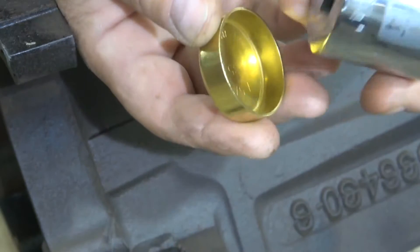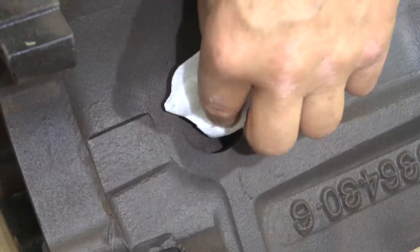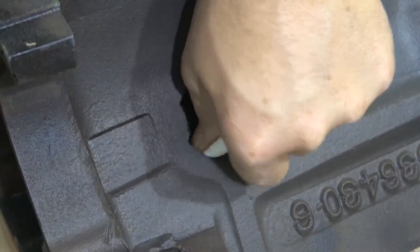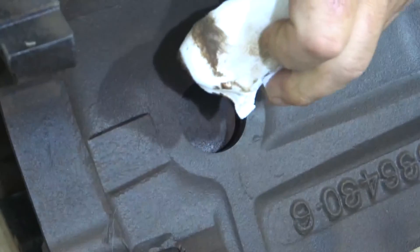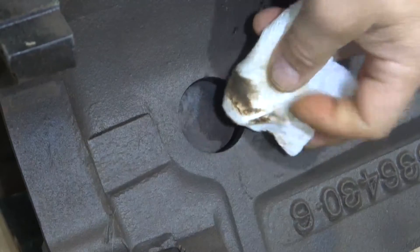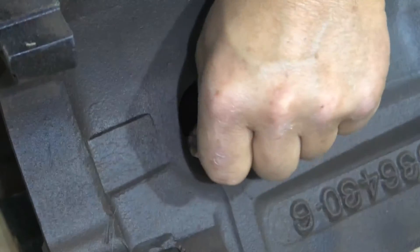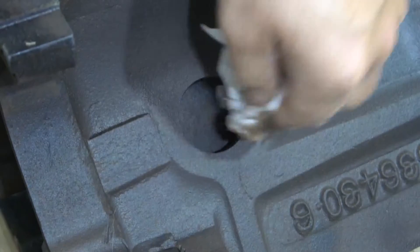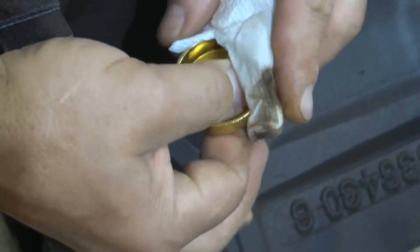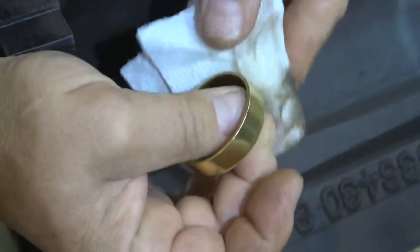This happens to be a one-and-a-quarter inch socket, which fits nicely on the outside of the plug. The first step is to clean the inside of the hole to make sure it's free of any contaminants — as you can see there is rust in there. So I'm going to clean that out. Some of that's in the water cavity. I'm going to clean the edge where the plug seats, and also clean off the outside of the plug itself so there's no grease or anything from my fingers on it.